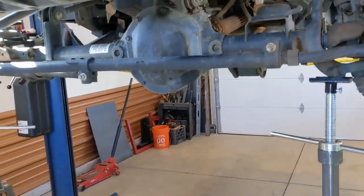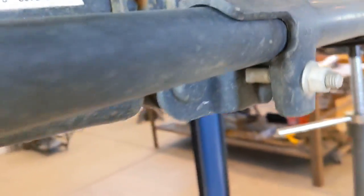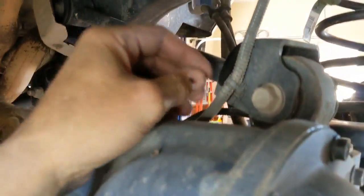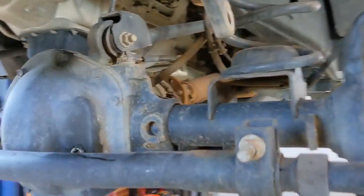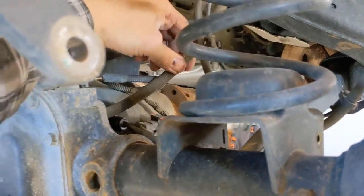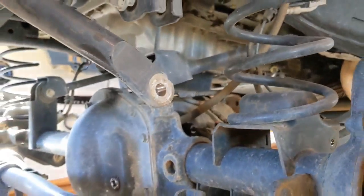Something not mentioned in the instructions but I always pay attention to — especially on newer vehicles with all the electronics — is that you have electronic lines going everywhere. Over here you have a line attached to the upper control arm. We need to disconnect that because it was getting a little tension. I'm going to pull that out so we don't do any damage, then check everything else. For example, you have a breather hose here — the breather hose still feels good so I'm not worried about that, but definitely this line I'll undo just to be safe.